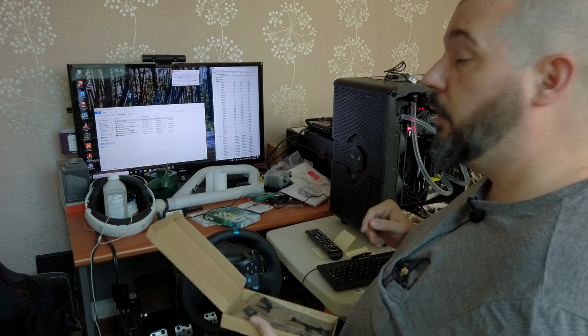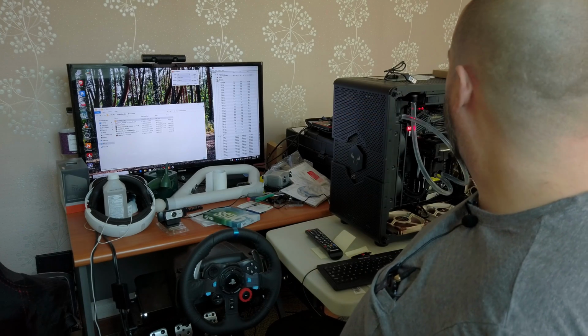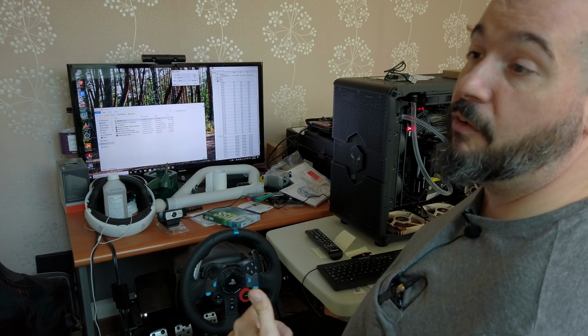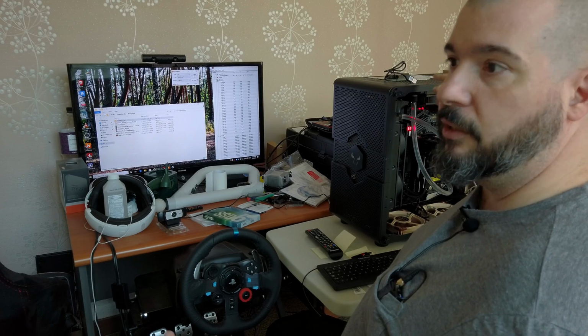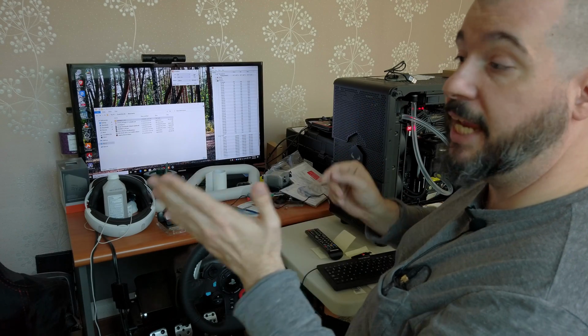So one thing that will do, if you're a bit tech nerdy, is due to the limitations of this board, it has enough PCIe Generation 4 lanes to run at full speed 1 graphics slot, so 16x, and the 2 NVMe slots, which is what I bought it for. Actually, it has a third one, but that one runs off of the lanes that are dedicated to the, it used to be called the South Bridge. It's just the board chipset, I guess now. Even though it has an additional 16x slot here, it does not have the lanes to support dual 16x. If I plug anything into that slot, it's going to drop it to 8x and 8x.